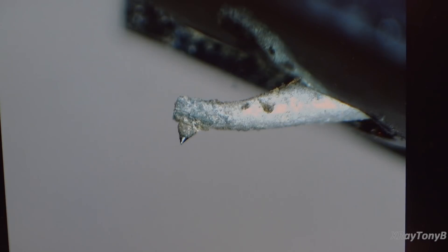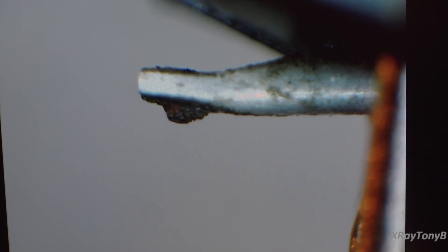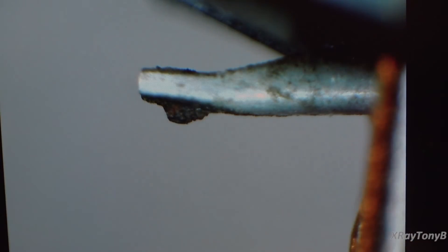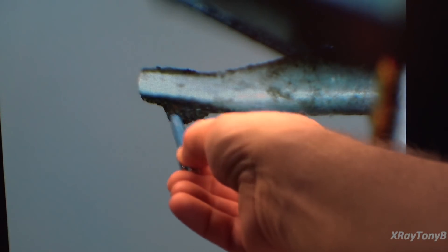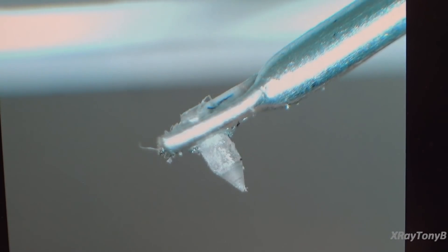The other stylus types we'll get into a little bit later when we talk about different types. But let's real quick take a look at that bad one we took off the old Hitachi. It looks a little bit different, doesn't it? You can see the tip has totally been worn off or broken off the stylus, so this would not work anymore. If you tried to use this on a record, you can imagine what all this gunk would do to the actual groove. That's why we had to replace the stylus, if not the cartridge. I did not have the proper stylus for that cartridge, so we had to replace the whole cartridge. For the sake of comparison, I just pulled the cartridge out of the turntable from that Hitachi video - here's the new one.